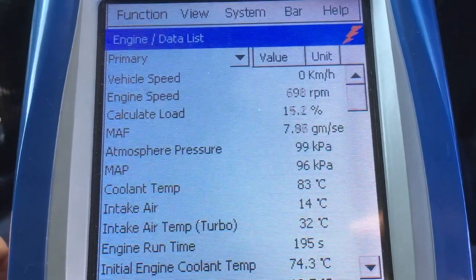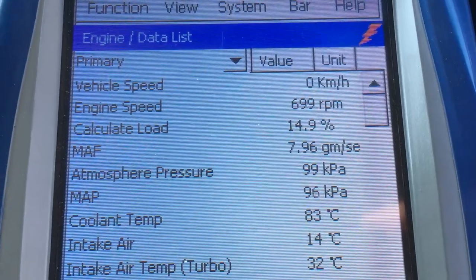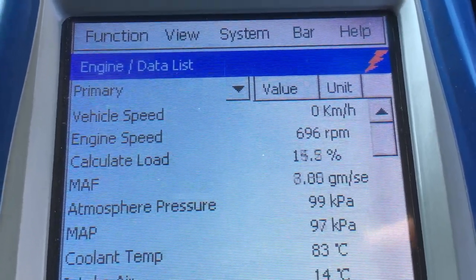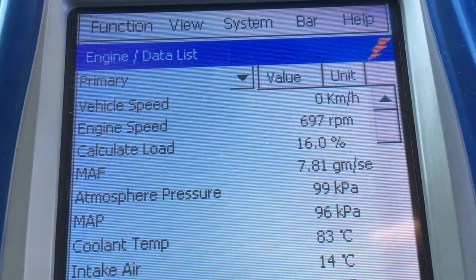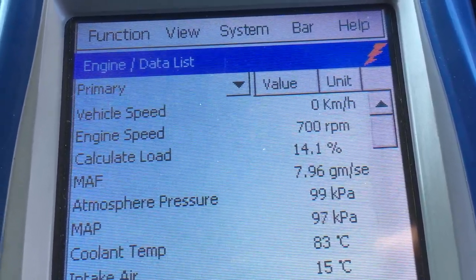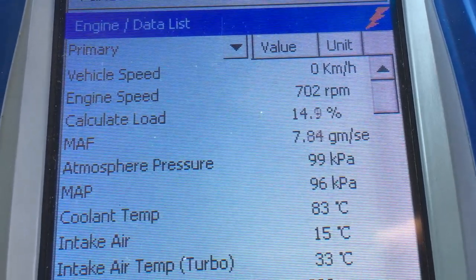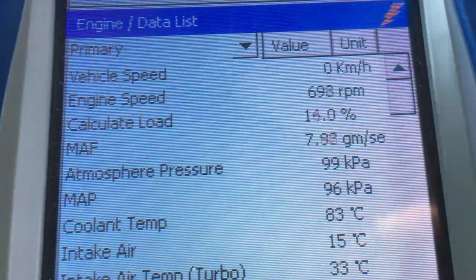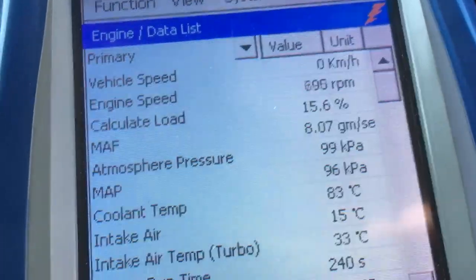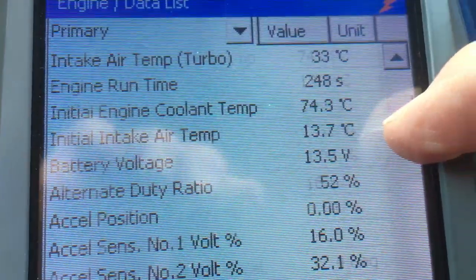Back to base. You can see the most important information — coolant temp at idle is 83 degrees. The load reading is 16, which is actually quite low considering 266,000 km's. So later in other videos you'll probably see blow-by, which means the injector seats are leaking. The blue smoke is because oil drips down onto the piston overnight after running the engine — the hot oil gets past those old, degraded, deteriorated seats. It's all explained in the injector information playlist — check that out to save your engine. The load reading going up around 16 is to the limit of their life, but I would have expected more like 20 or 25. Anyway, there's a surprise. Let's just slide down and have a look at those other important readings again.